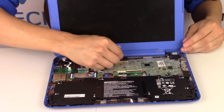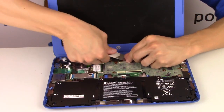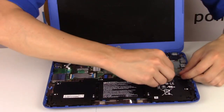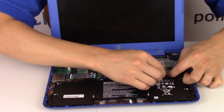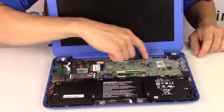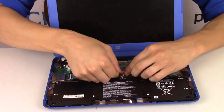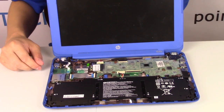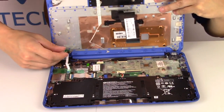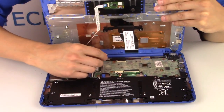Taking a picture when you're new at this is always a good idea. Now the video cable — make sure everything's in there nice and secure and flush. I'm actually going to reseat this one because I think I may have got it in crooked. There you go. Get your speakers over here — there's not a lot of room in that cable. Got my ribbon there. Last but not least, plug in my battery. Now that the motherboard is back in, I'm going to put back in my ribbon cables here. Be very careful with these clips — they're very flimsy plastic and very breakable. I'm actually surprised I didn't break any of them when I tore it off earlier.